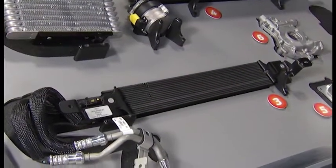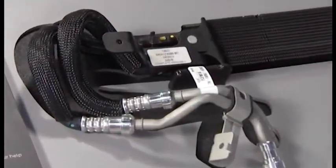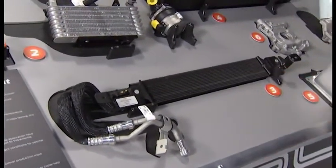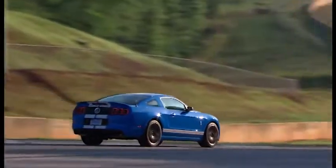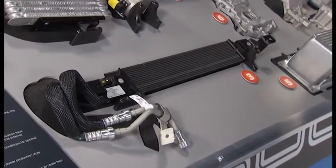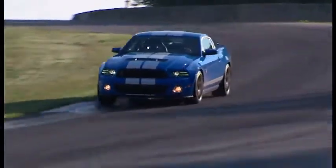Next I'm going to talk about the optional transmission oil cooler that you see here. This is mounted in the upper grille opening at the front of the car. It's connected to the manual transmission which, on the optional package, has an additional feature — a mechanical oil pump. That pump routes the transmission oil up to the front of the car through this cooler so that the customer in a track use situation is able to keep their transmission at its optimum operating temperature. The system is very unique — transmission oil cooling is something that is done on automatic transmissions. It's very rare that you see something like this on a manual transmission, and it's something that is really only required when you go to the track and have that repeated hard acceleration use that this car can see.